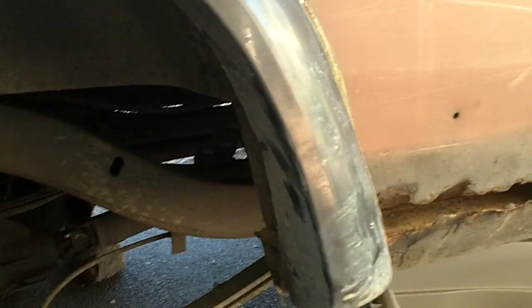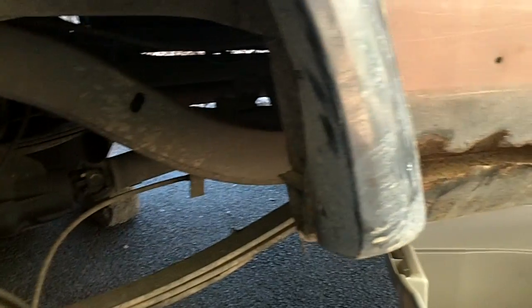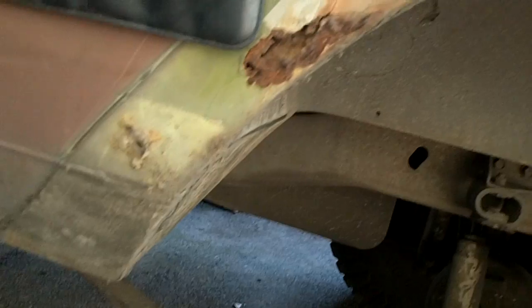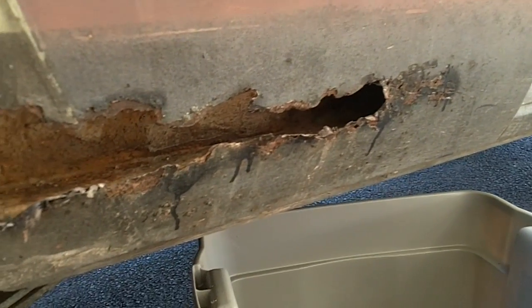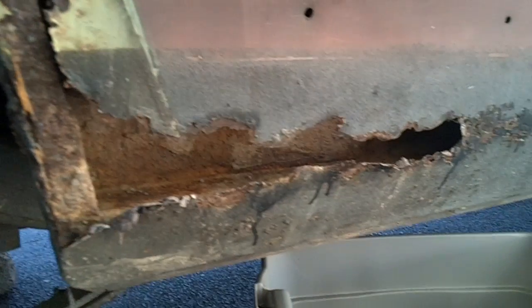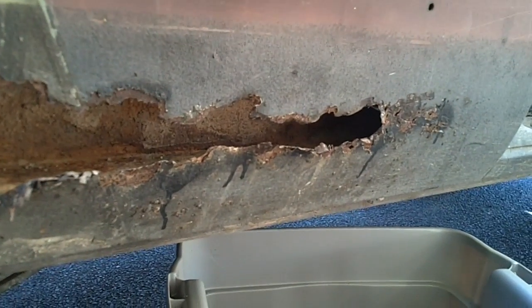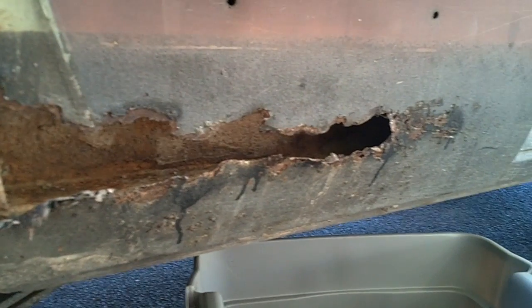He always had the fenders only on the rear tires, not on the front. I figured maybe he just bought one pair. I pulled these off and got an interesting crack cut all across there, so we're going to be redoing this wheel well. I opened this up — it was just surface rust, but it was paper thin. This is the typical scout rust area for the Terras and the Travelers — the extended 18 inches that they extended from the Scout. That's its prime rusting area.